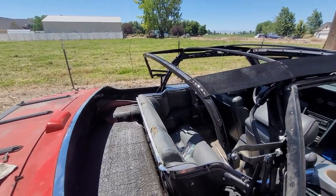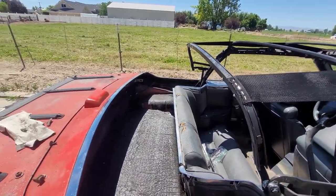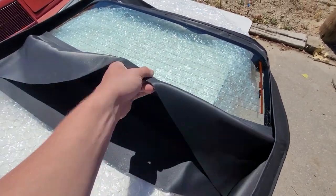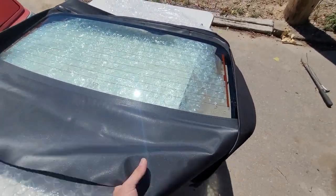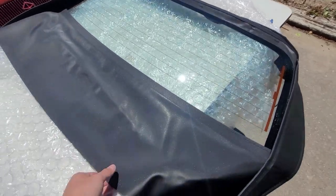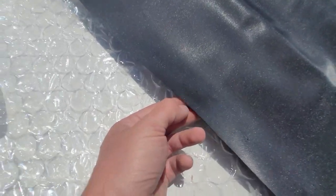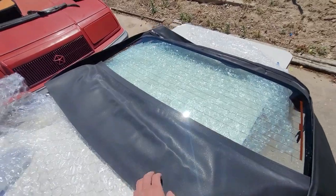Now it's time for the scary part — we're ready to put the window section in. Let's move over to the bench where we've got the new section laid out. This is the outside because we've got the vinyl facing out, with these two layers and then the cloth interior. You can see all these little puncture holes — these are kind of like the factory guess marks of where the staples should be. I think this mark right here is the center mark, but we're going to double-check that with our yardstick before we staple it onto the trim sticks.